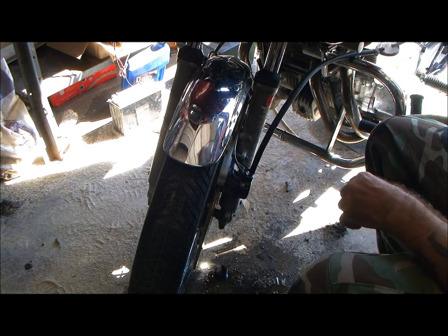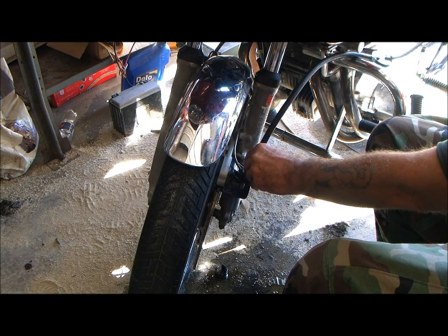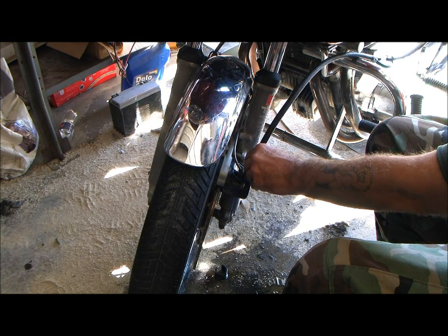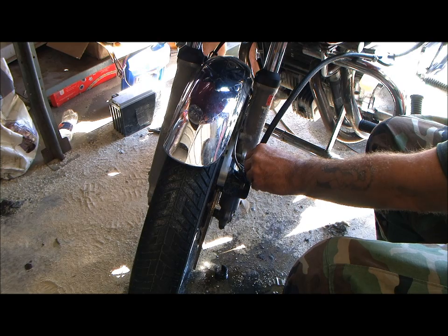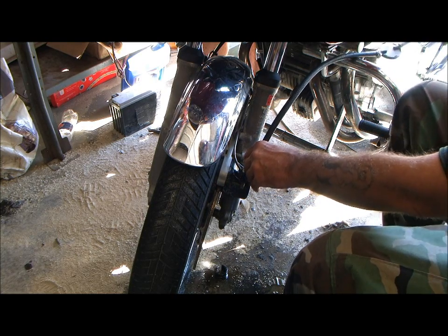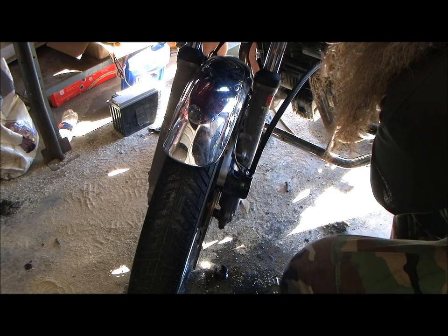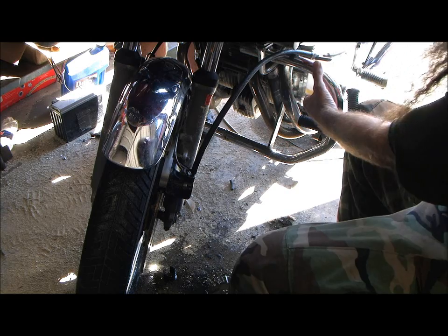Alright, now, keep that top in the master cylinder topped off. Hold on, wait. I'm already sucking air. Sorry. Now your whole secret down here is just keep flushing it through until it's all the way clean. When this can comes out clear, then you're done. And y'all can't even see that can. Alright, so okay, y'all can see the can.